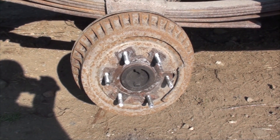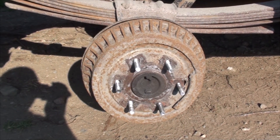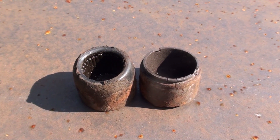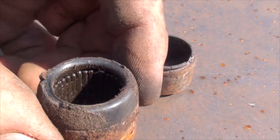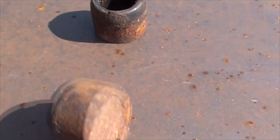I have the wheel off, and you can see it used to be a 5-bolt pattern that I changed to 6. I have drum brakes on the back — I hate those, mostly because they don't match the front and I have a thing for symmetry. What you see here are two needle-bearing caps off my U-joint, the ends that were attached to the differential yoke. This U-joint was brand new last spring, bought from a reputable parts store. The needle bearings are perfect on one side, but there's not a single one left in the other side — they completely turned to dust. I had vibration problems with this rear end before and after that new U-joint was put in and disintegrated.